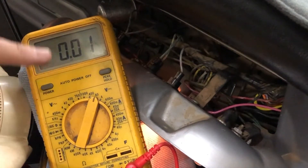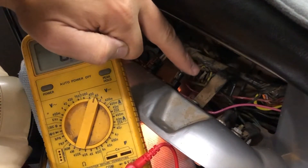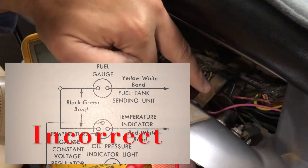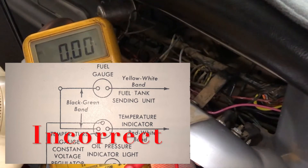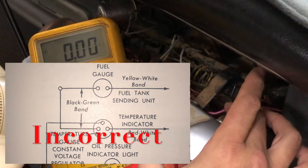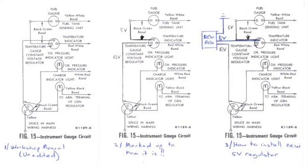I could tell straight away that the wiring was slightly different to the workshop manual — the workshop manual is slightly incorrect. Based on what I've tested with the multimeter, this is the live 12 volt feed coming in with that spade style connector, and we've got the five volt connector on top of the temperature gauge. Because I've uncovered what I believe is a discrepancy in the original workshop manual, I've taken a couple of photocopies and marked up by hand the differences — the original manual on the left, my markup of the actual wiring in the middle, and the modification I intend to do on the right.